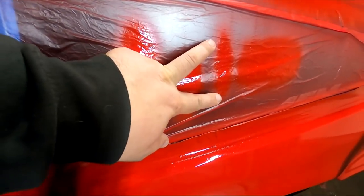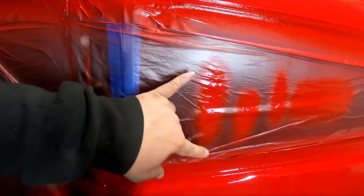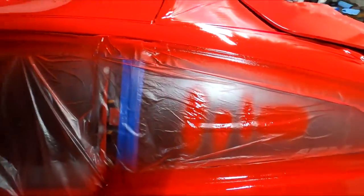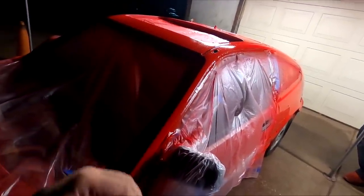Not gonna lie to you guys, we had some issues with the paint gun. The harbor freight paint gun — I normally just use them for a couple of times and toss it, but that gun probably has about four run times on it and I cleaned it out every single time. What had happened was the needle that controls the fluid was gunked up — the needle didn't allow the fluid to come out enough. If you look at the spray pattern, it's maxed out and it's only about four inches wide. I was trying to figure out why we couldn't get a wider angle, so I had to literally stop, take apart the gun, clean it up, and get back to it. It sprayed a little bit wider but not how it used to spray — which was like an eight to ten inch span. Because of that issue I just continued spraying and figured out what the gun was doing as far as spray pattern and fluid output.